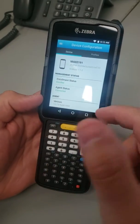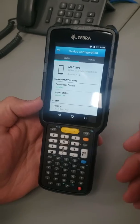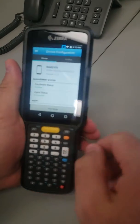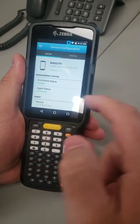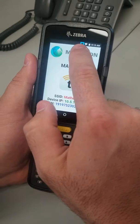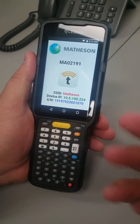When you're done and you want to put it back in lockdown mode, you're going to do the same thing: hold the blue button and hit the P1 escape button. You'll be prompted with an icon that says user mode — tap on user mode. That will lock it back down. You'll notice there's still a blue square up here; just hit the blue button one time for that to disappear. That's all you do.